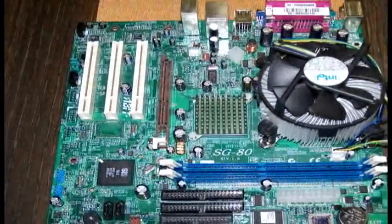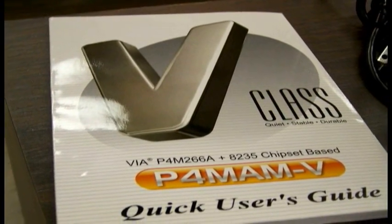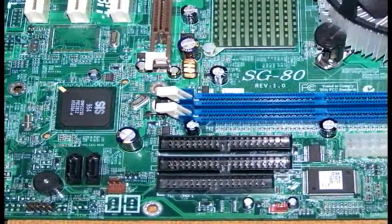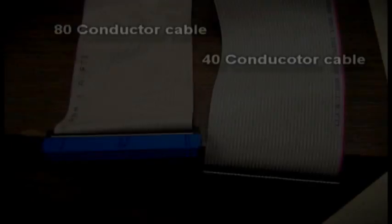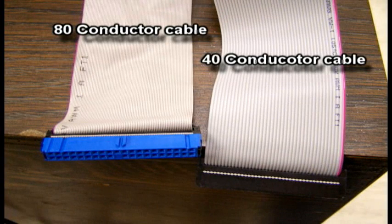Now is the time to plug in the drives. In this tutorial I will be using IDE cables for my drives. Start by locating where the IDE connectors are on the motherboard, then use the motherboard manual to locate IDE connectors 1 and 2. You will be connecting the hard drive to IDE 1 and the DVD drive to IDE 2. Use an 80 conductor cable for the hard drive and a 40 conductor cable for the DVD drive. Be sure to have the red stripe on the cable go to pin 1 of the connector. You can tell the difference between the two cables because the 80 conductor cable will have more wires with the same amount of pins as the 40 conductor cable.